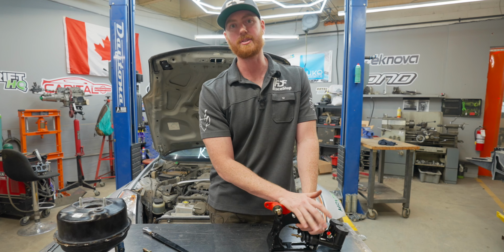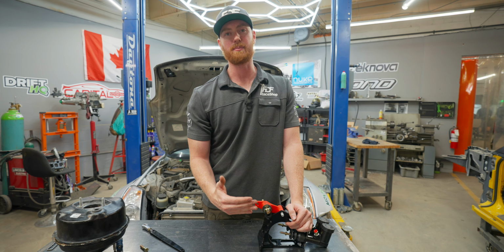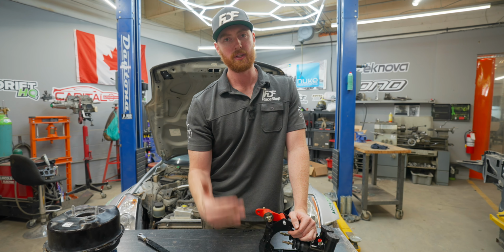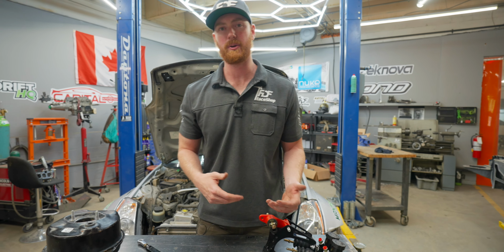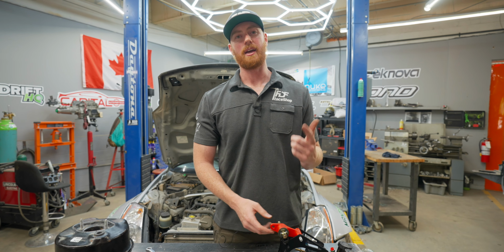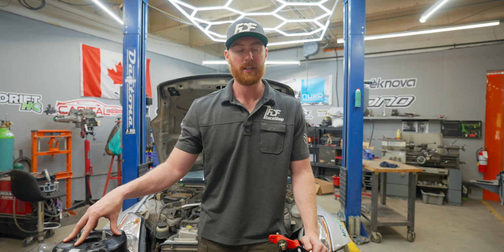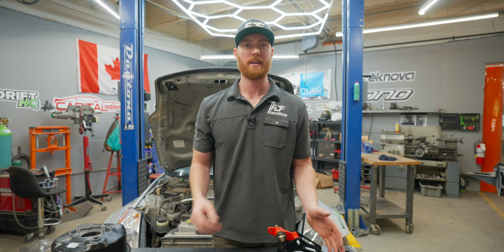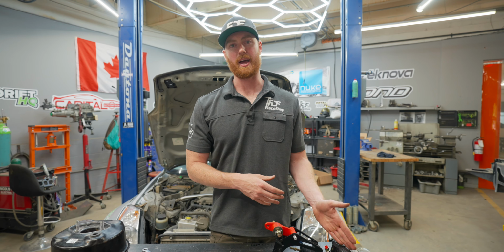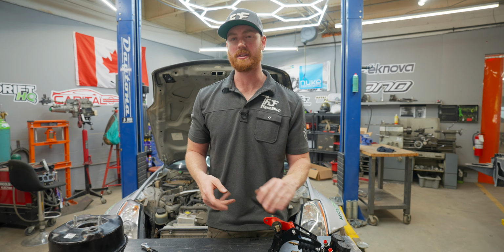When you consider using manual brakes on a car, you're just going to have the exact same brake pressure at idle throughout your RPM at any given speed, and the same amount of brake pressure is going to do the same amount of work. And the same could be said if you decide to run a vacuum pump on your booster system. But personally, I find these are too sensitive for racing, and I just size my calipers and masters to allow for a good feel that's nice and rigid, but also I can lock up all fours if I need to.